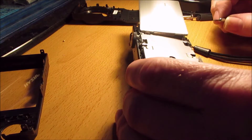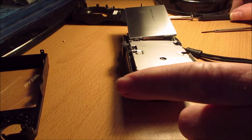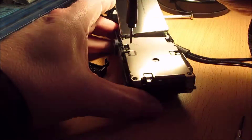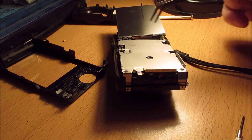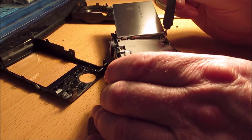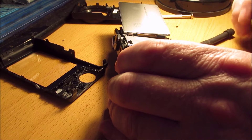So I will just point out the screws on that side and another two just there. The next task will be to get those screws out so I can take off the back plate to the LCD screen. I have speeded this bit up. The screws are really small and fiddly, so you need to make sure you have got a small screwdriver, similar to what I am using — one from a glasses repair kit. Sometimes it is easier to use the tweezers rather than your fingers to get the actual screws out.